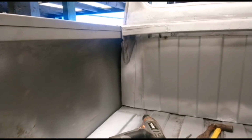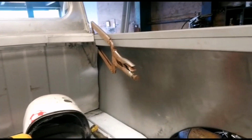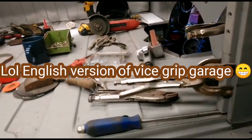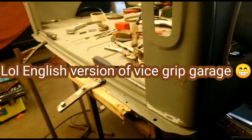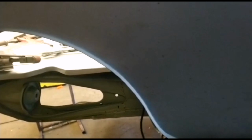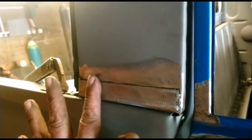As you can see, the back brace supports are welded in. And on the off side where we had that little bit of rust up on the top there, that's now been cut out. Little plate nicely stitched in with a step joggle, so it's all nice and smooth. You don't have a hard weld edge.